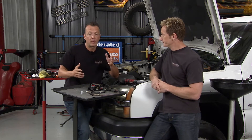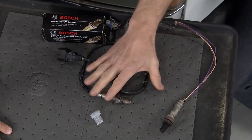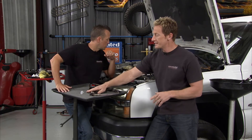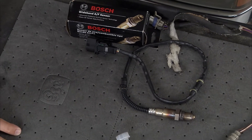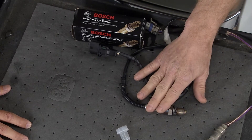With the narrow band you get a reading, but basically that reading just says it's off — it's off this way or off that way — there's nothing precise about it. That's where the wide band comes in: it'll tell you exactly how far off it is. There's also a heating element inside the wide band O2 sensor. One of the problems with cold start on electronic fuel injection is everything is cold and things don't really dial in until they get to temperature. The same thing can happen with the O2 sensor — you wait until it heats up before it starts giving accurate information, otherwise the engine compensates for being cold rather than tuning properly.